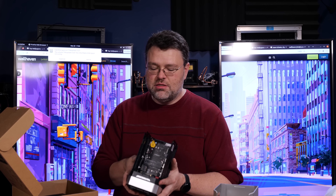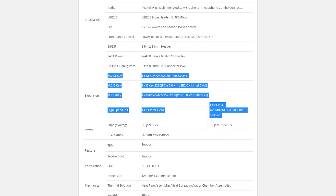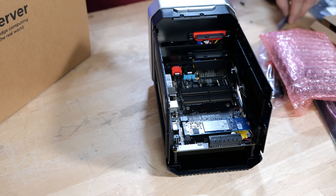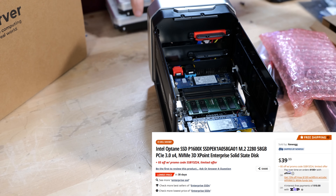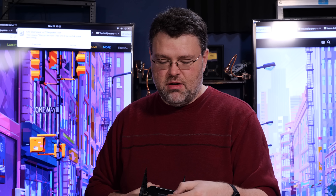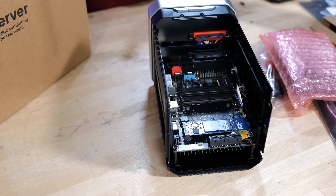The bottom here — and it's so tiny, barely bigger than a stack of two hard drives. It's important to keep in mind the M.2 configuration: you have four PCIe lanes for your M.2 at the bottom, but at the top it's only one PCIe 3.0 lane and one USB 3.0 lane. I picked up a bunch of Intel Optane on sale — two 58 gig Optane modules. These are only two PCIe lanes and aren't the fastest, but I'm going to use these for caching in our TrueNAS setup. I wouldn't want to use two high-performance NVMe drives because it's not going to run that fast without an adapter for the PCIe x4 slot.